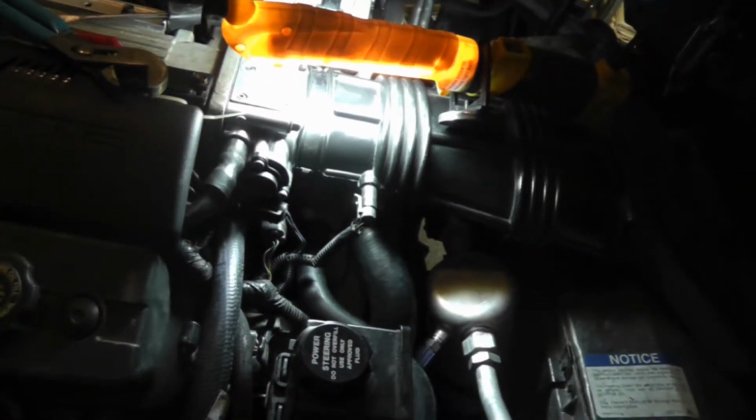It's going to push the air out, and once the system is full, you'll see coolant start coming out of those two bleed holes. And then when you see coolant coming out, you stop filling and tighten them up. So now with both air bleed screws open, you start filling up the system. When you start seeing coolant come out of the screw, you know the system's full.